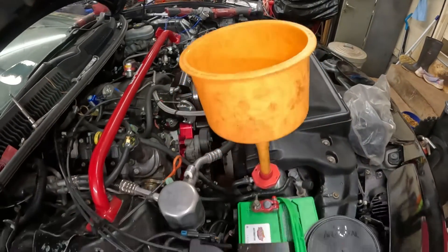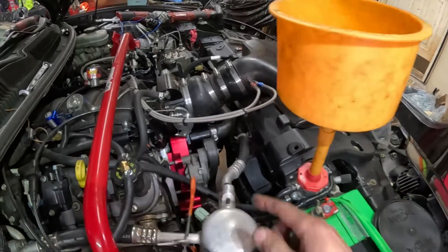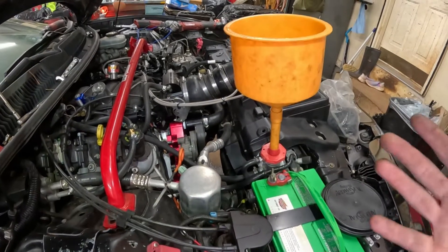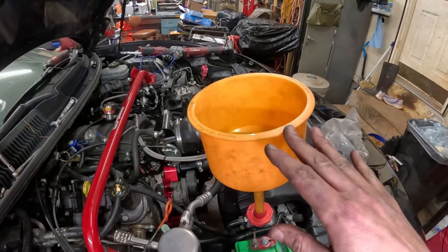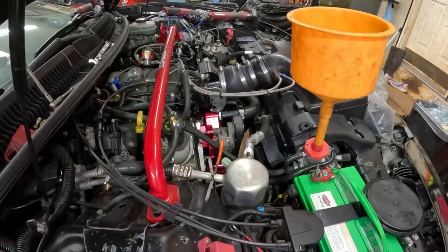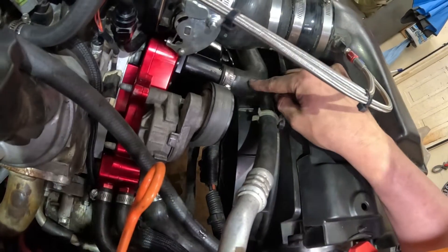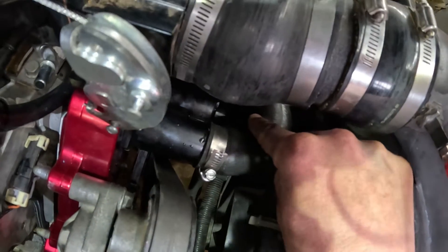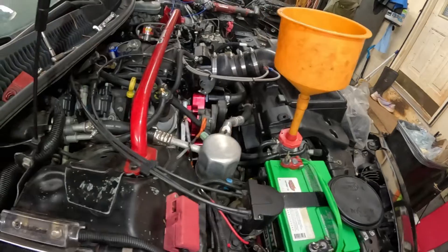I do have our coolant reservoir hooked up. One thing I noticed with how tight my coolant system is — I had to take my upper radiator hose off because it was air locking. That's something I'm going to start doing more often because I've been having issues burping this car and getting the air out of the coolant. A lot of it is because you pour your coolant in too fast and it creates an air pocket, so pouring it slower is one solution. You can see our upper radiator hose is rubbing right in here — it's pretty tight.